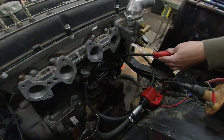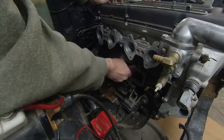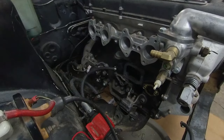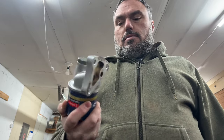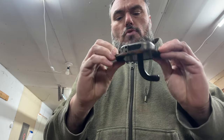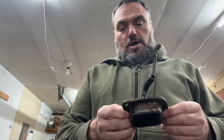Hopefully there's a good gasket behind that one, and if not, some RTV will go in place — which I clearly don't have. It's always good realizing while you're filming that you don't have what you need. It took a while to scrape that plate off — I had to use a pry bar and get a little forceful with it. I also had to remove the oil filter housing because it was blocking a bolt, and I broke the gasket on the oil filter housing, so we get to replace that. Seems easy enough to make, but I'd like to source one if I can. Speaking of gaskets, also broke the one on the plate of course, but the new breather has a gasket on it already that seems serviceable.